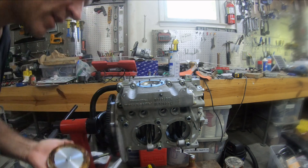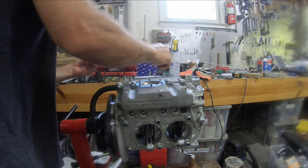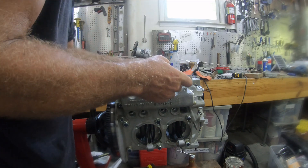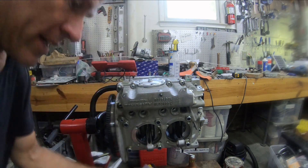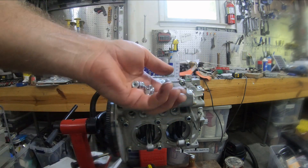I bought a magnetic oil plug, and what that'll do is attract the little shards of metal that come off — kind of like the magnetic plug in the gearbox. I bought one of those also for the drain plug here, and I'm waiting for that to show up in the mail. My Permatex is on there. Let's hope that these studs are long enough — they appear to be. I think that is going to seal just great. So I'll put these guys on there.